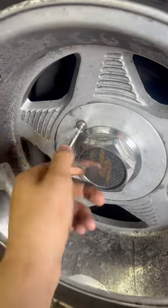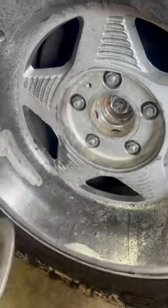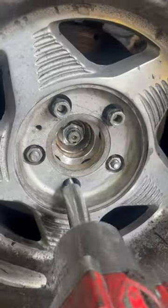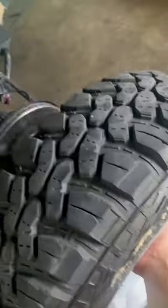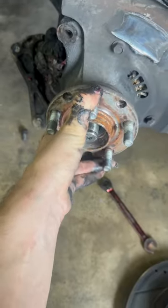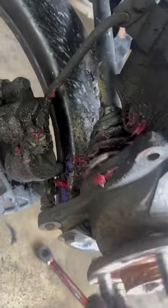So let's start by taking everything apart and seeing how it looks and if we can fix it. I obviously start by taking all the lug nuts off so I can take the wheel off. Just look at all this play — you want zero play in a wheel bearing, and I have an excessive amount. So bad, in fact, that it caused the axle to dislodge itself and break everything inside that end piece.